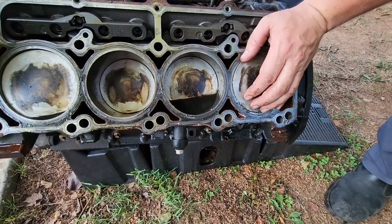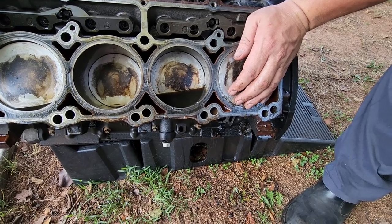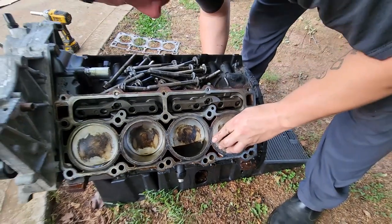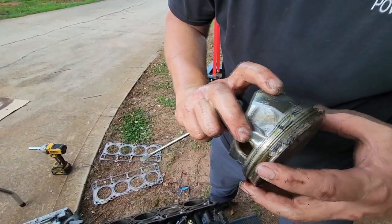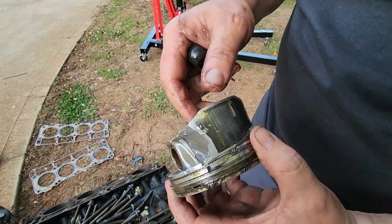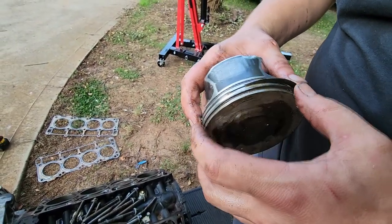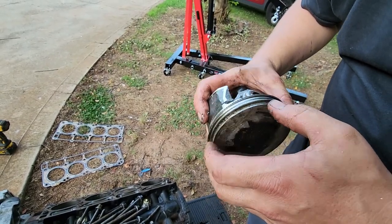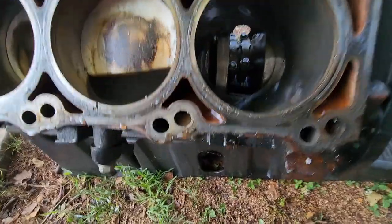Come on baby. I'm literally inside frostbite right now. Come on. There we go — how about that? I don't know if that's... I think this is carnage from the other rod breaking. That's my theory. But if you look — the part that always breaks on the Hemi guys is the top of the piston skirt. The top piston ring and the ring land usually cracks. And there's no fractures on this piston from the top or around the rings. It's all carnage and broke down below because the other one snapped — when it busted it went crazy.